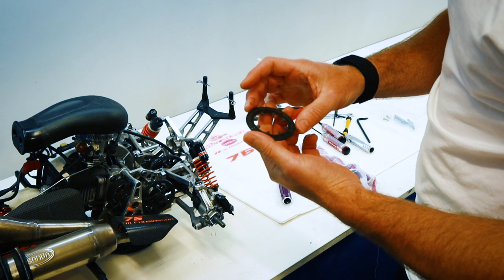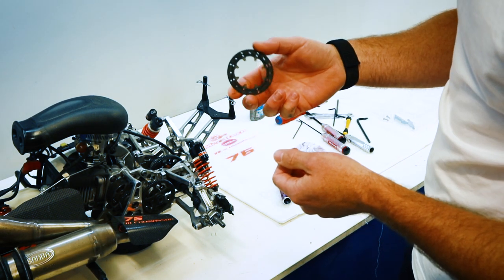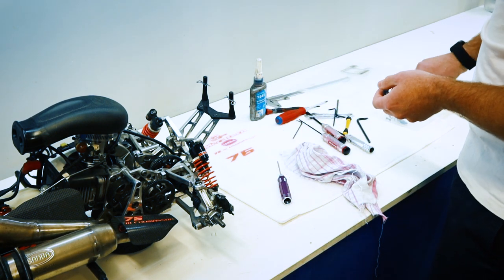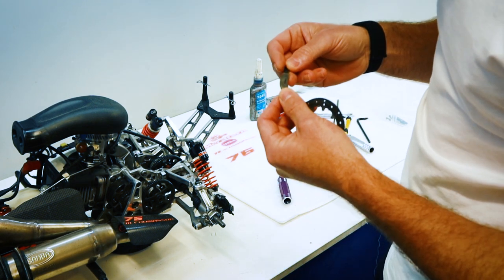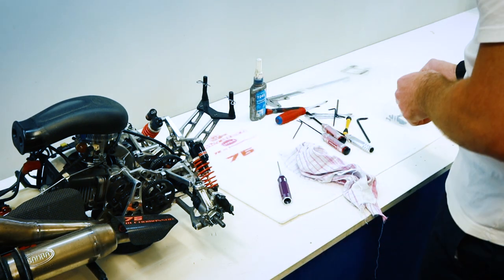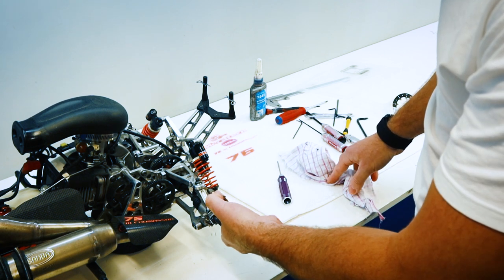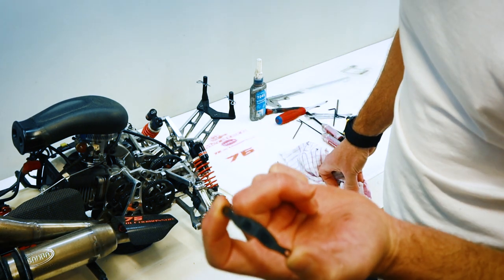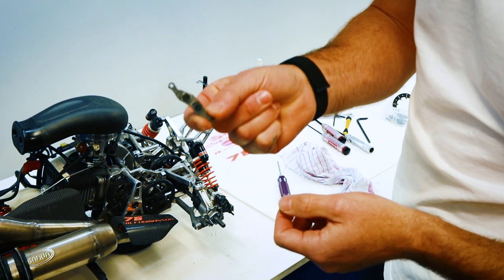Take the disc off. You can see on the disc, a slight bit of contamination there probably. These are a fibre disc with a steel pad on the Mecatechs, opposite to what you get in a car. In a car, you obviously run a steel disc and fibre pads. Pull the next pad off. A little focus, you're going to see a little bit of residue there.